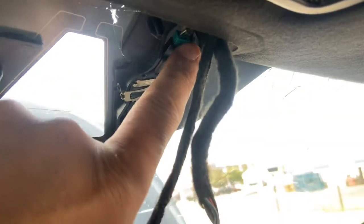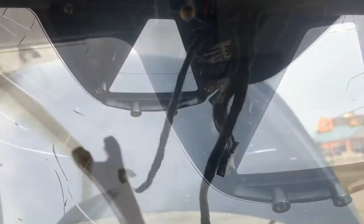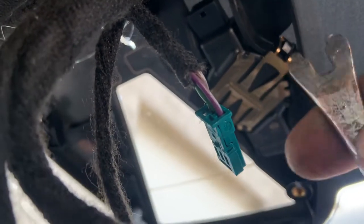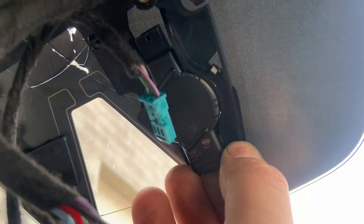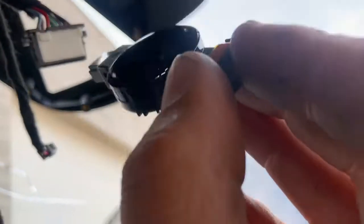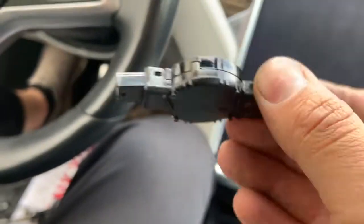Okay, this is what we're left with now — we're almost there. Here's the rain sensor and there's the plug. The next step is just to remove this plug and then on this side we have another plug to remove. All the plugs are off. The only thing left now is the rain sensor, and to remove that there's a metal bracket — just move it out of the way on both sides, take this bracket off, and then gently grab one end and pull back very gently. You're going to feel the rain sensor pad releasing, and off it comes. There's the pad — put this somewhere safe.